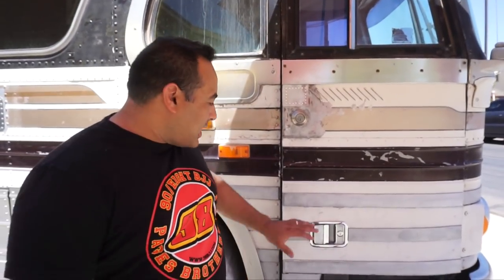The next adventure was sourcing all these handles, wires, pulleys, and everything to get the door handle to operate the same way it would in a big rig. After we got back from Quartzite, we started looking around. There's a guy who published an article with the exact parts you need — Kenworth or Peterbilt parts — with part numbers for the strike plate and everything. His total cost was about $150 for the mechanism, the clamper, the strike bolt, and the inside piece.